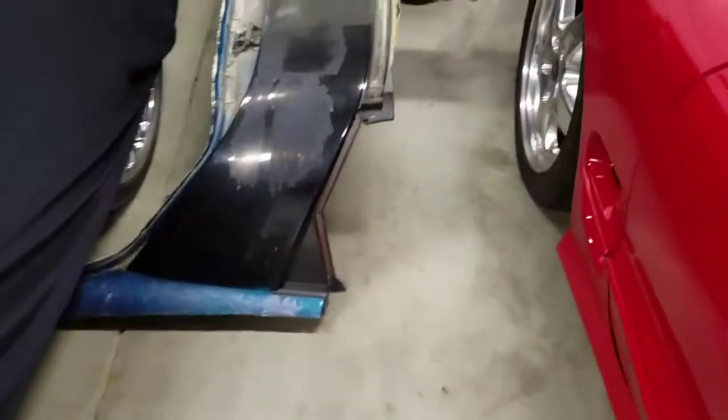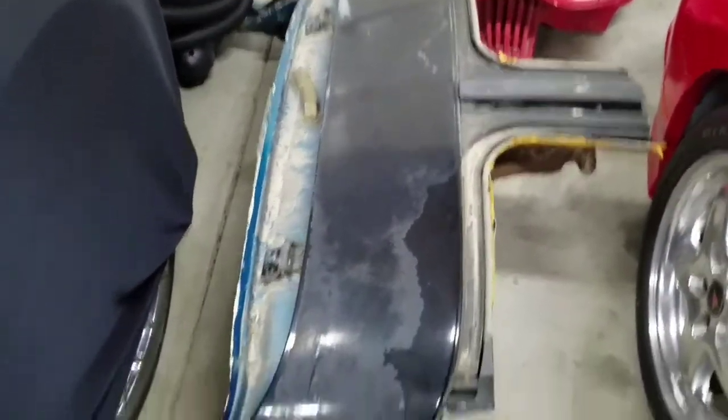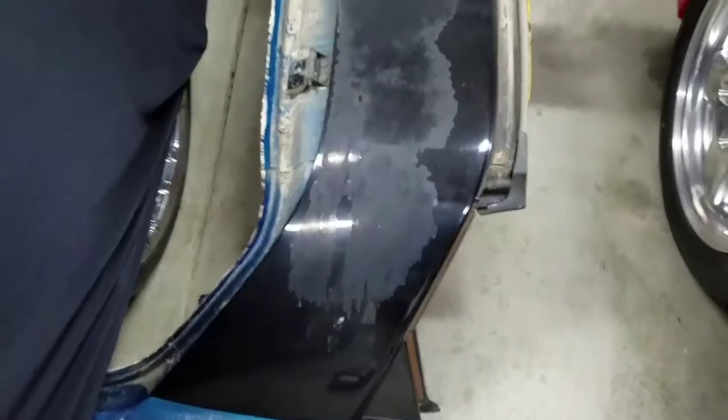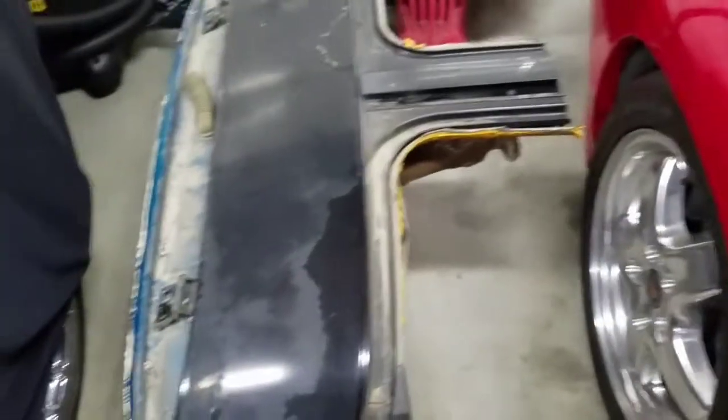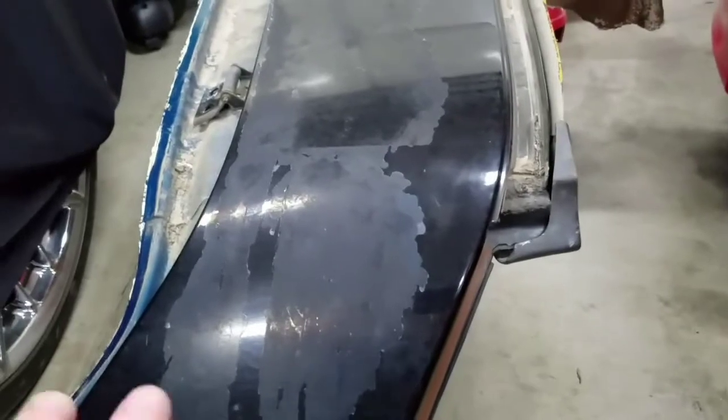And so today I went to the salvage yard and got one off a 93 to 98 Camaro Trans Am Firebird. As long as it's a T-top car, obviously. So what you have to do is you have to skin this thing. From the bottom here, you piano wire all the way up and across. And so I'm going to do that. Take this off. They need to epoxy coat the top side, the bottom side, then paint it back red, obviously.